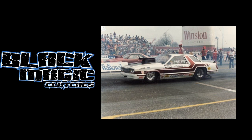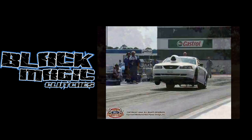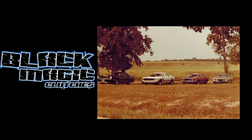A lot of our cars are old small tire cars, old back in the day hot street stuff, that had certain limitations of what we were allowed to run. We usually built ignition programs through the Digital 7-box. Obviously now we've got a lot more options out there, with the Power Grid, things like that. So basically what we're trying to do here is eliminate that tire spike. Sometimes you can't literally get that slippage out of it. Without changing the ratios every run, you're just not going to be perfect on that combination.